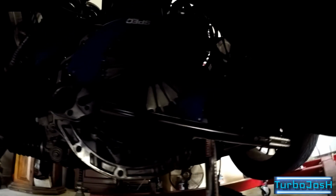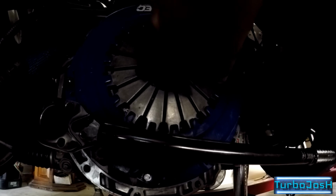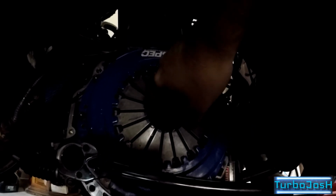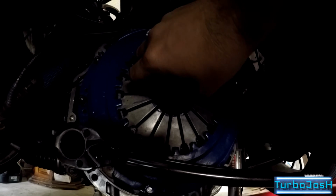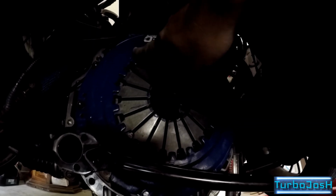Unfortunately, for the flywheel, I have no spec because I got pretty much ruined by spec. I don't even want to go to that particular story. On the flywheel, I went to 93 foot-pounds. I did 3 sets, 33 foot-pounds, 66 foot-pounds, and I think I did like 94 foot-pounds on the flywheel. Clutch tool, clutch disc in, make sure your FW side is for flywheel side. That goes on the flywheel side, obviously. And then the clutch, I'm doing it 14 pounds and 22 foot-pounds.